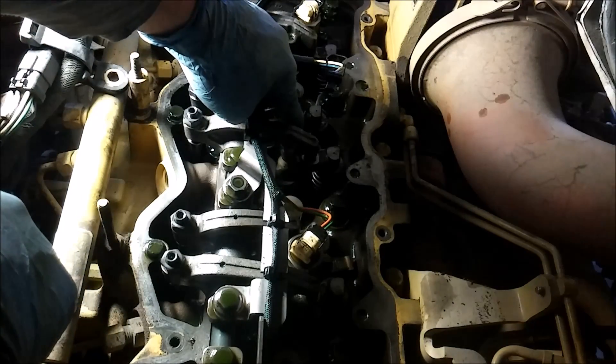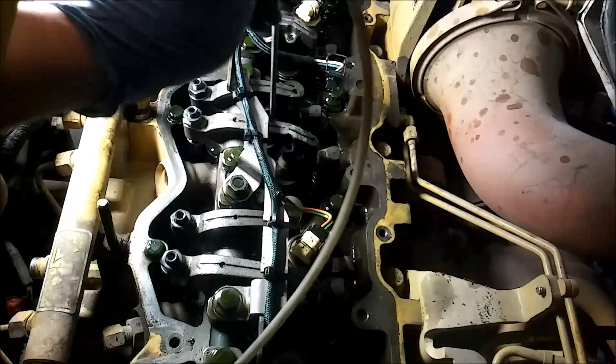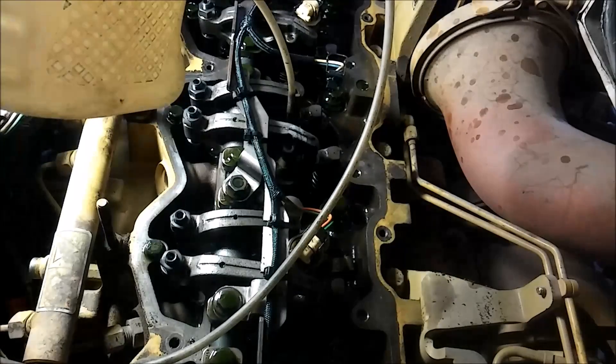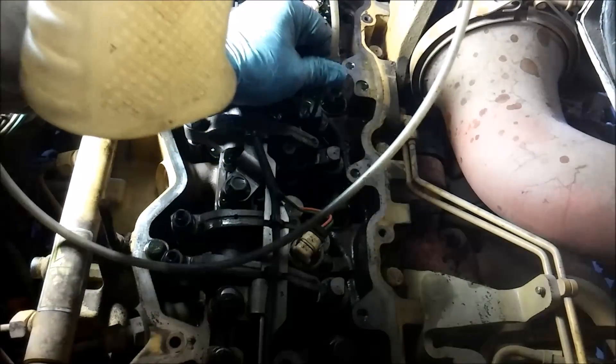So we've got our injector out. First thing we're going to do is clean the injector bore using trusty brake clean - I just spray it down the injector bore. What that's going to do is remove any residue, fuels, and carbon that's in that injector bore, and wash it into the cylinder. Then I take this OTC brake evac system that I've outfitted with a little bit of extra longer hose, and we're going to pull all that fuel and brake clean out of the cylinder, because you don't want that in the cylinder when you first fire it up or you'll get hydraulic lock.